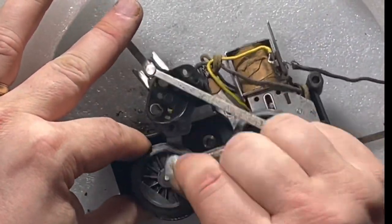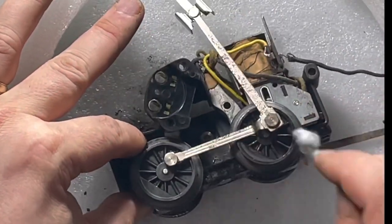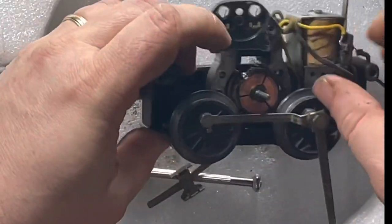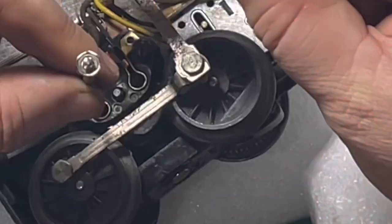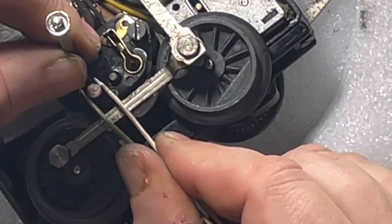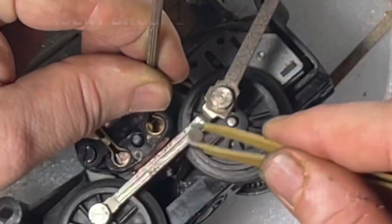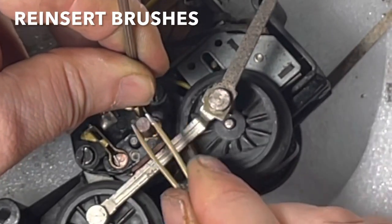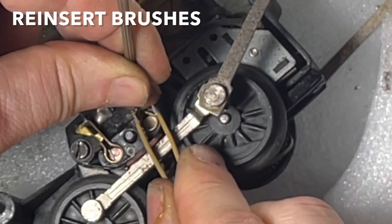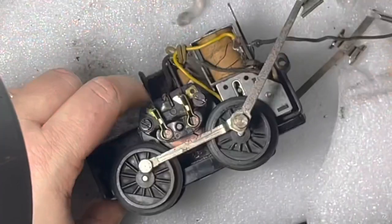Since I'm in a cleaning mood, we'll go ahead and clean the wheels too. Now putting the commutator back in, it's time to put the brushes back in and put the motor back together. These are a lot cleaner than they were before. I'm wondering if I can actually get this thing going to a pretty good crawl if I clean it enough — we'll see and give it a test later.